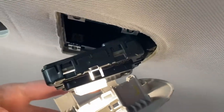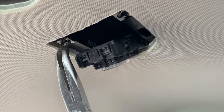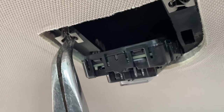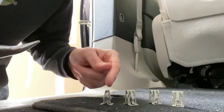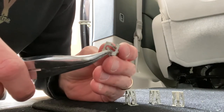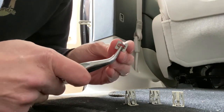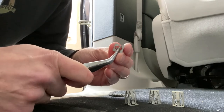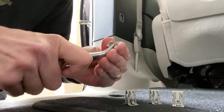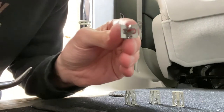Right in there — snap it into place. I've got a pair of needle nose pliers. I'm going to remove these aluminum clips — pinching the inner tabs, you can carefully remove those. I've got all four clips removed. On the bottom portion you've got those little teeth. I want to push those and reseat them back inside the clip. Apply just a little bit of pressure to the teeth and push them back in position inside the clips. They don't have to be flush — you just want them inside a bit. Flip it over and do the same thing until it pops through, and now they are reseated.